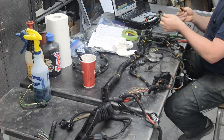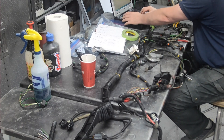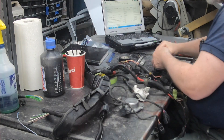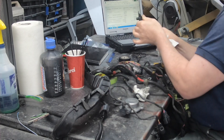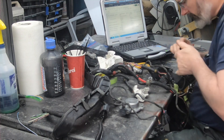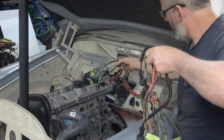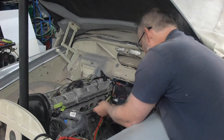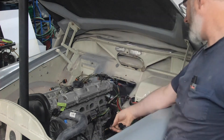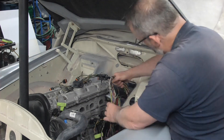The weather's good, so we ran out to the junkyard and got a wiring harness. I'm not going to use this wiring harness — I'll explain why later when I actually start covering the wiring of the car. But it's just good practice to get an existing wiring harness, which I never did have for this particular project, and get everything mapped out. I've got the computer open, getting all the sensors, all the wire gauges, all the wire colors. I'm just building a database of what's going to be needed to get the engine side wiring harness done up for this car — every little detail including where it goes, laying it in, making sure I've got the right brackets, making sure things are going to lay out the way I need them.